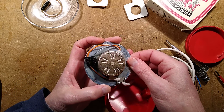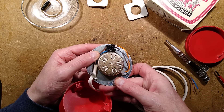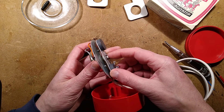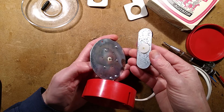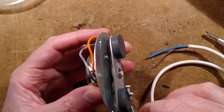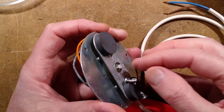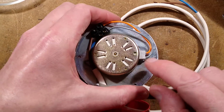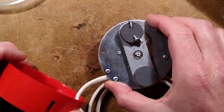Is there any more information on the case? It's made in France - Brevet - not an awful lot of information. But the design is very simple. It's actually got a little plastic insert and then just a thin shaft that would normally go into the cog wheel in a gearbox, but in this case it goes into a specifically made plastic bush. There's the motor, there's the little pin coming out, and there's the bush with the metal plate with the magnets, and then this retaining ring just pressed on. That will turn at a speed determined by the number of poles versus the mains frequency, and agitate your wash.